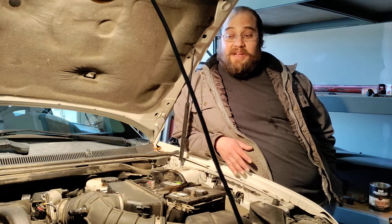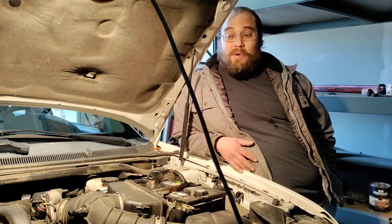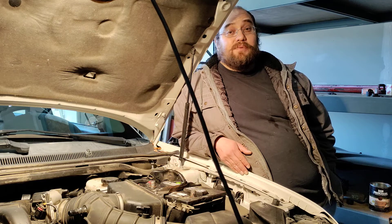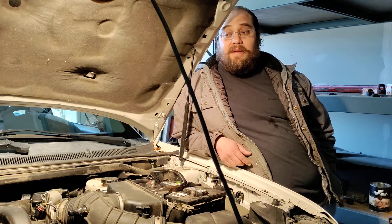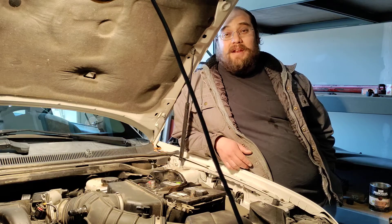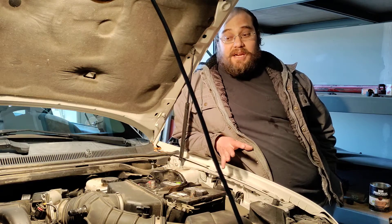It's been low on coolant for a few months and nobody can figure out where the coolant's going, so we're going to go in there and fix the water pump. Also, the other day there was a report that upon startup there was a growling, kind of a grinding sound coming out of the timing area. I suspect that's going to be a timing tensioner.